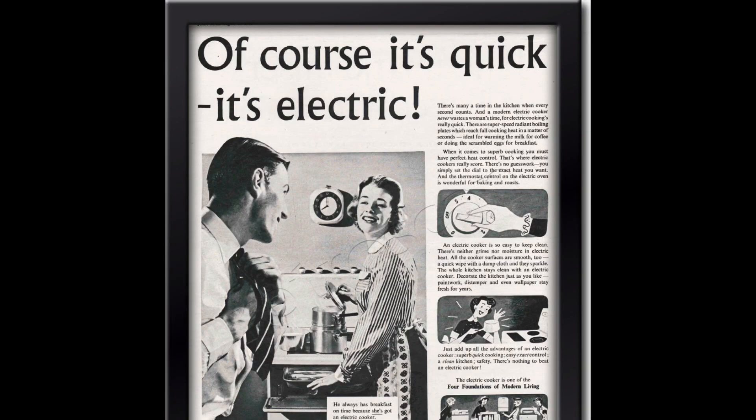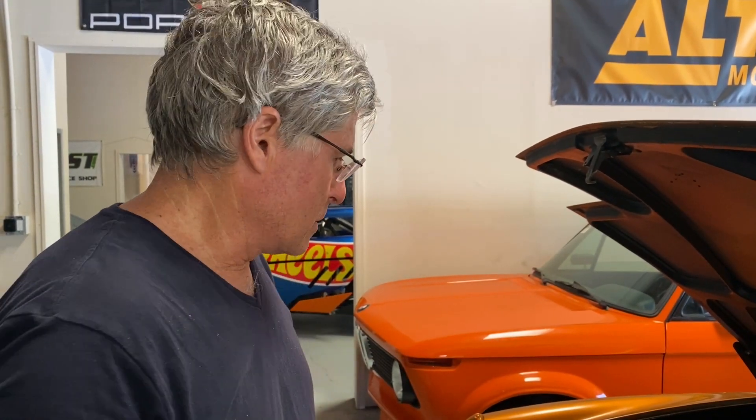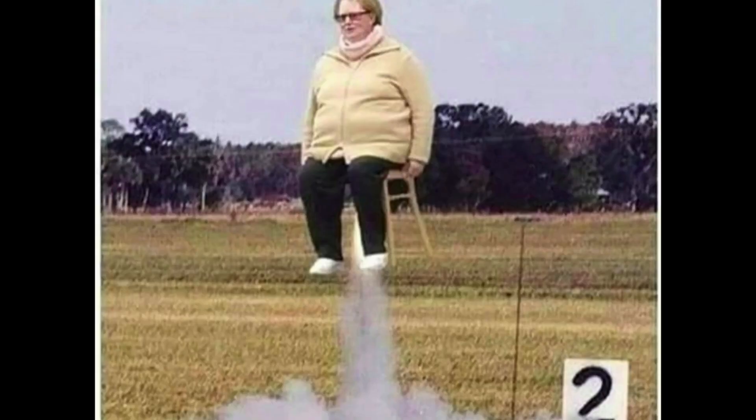This is old school — like 10, 12 years ago, this was a state-of-the-art EV conversion. A lot of people were choosing the 914 because you had all this room in the front and all that room in the back. You saw the controller took up the back trunk. And look at this — you had to have these ventilation hoses for the boxes, because lead-acid batteries outgas. You had to have a place for the gas to go, for them to breathe.